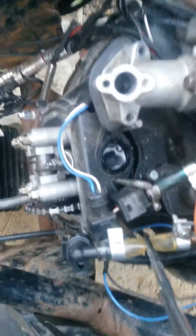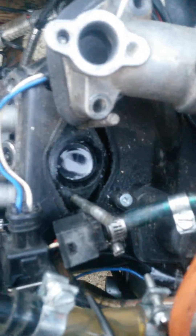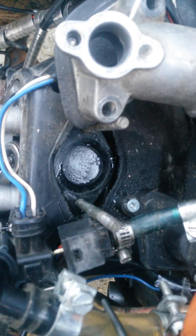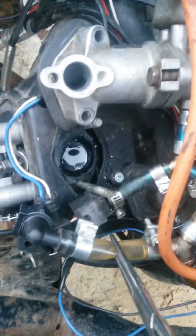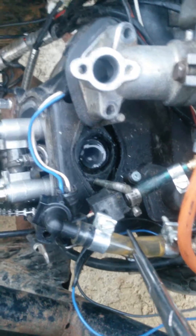So this is how I would check the intake valve. First you fill the intake with gasoline, put the engine in compression and slowly push down. And if you see bubbles, that valve is leaking. Now I'm not completely sure how to remove the gasoline again, but we checked and that valve is definitely leaking a lot.